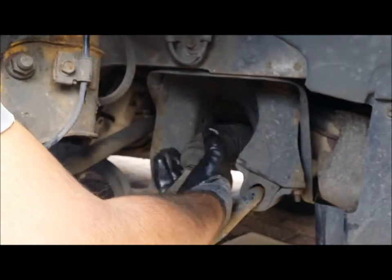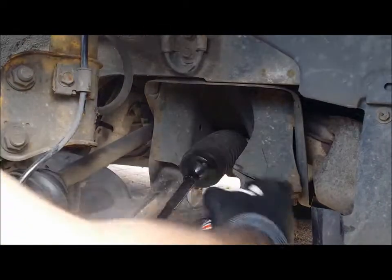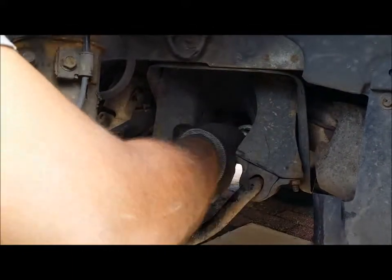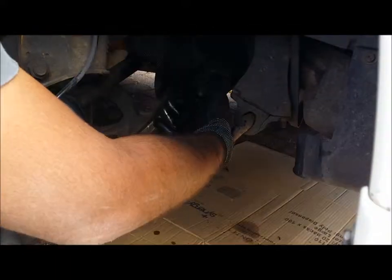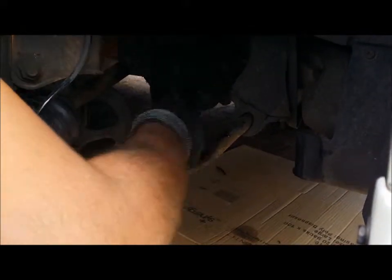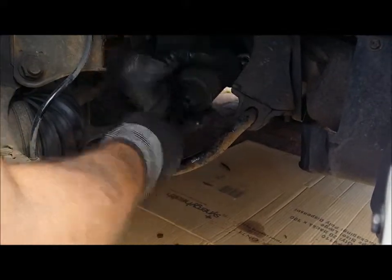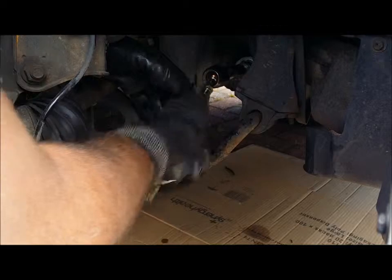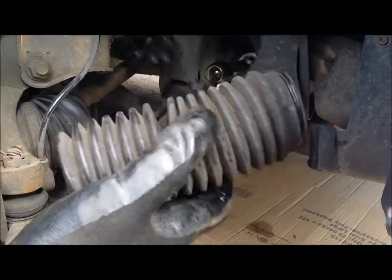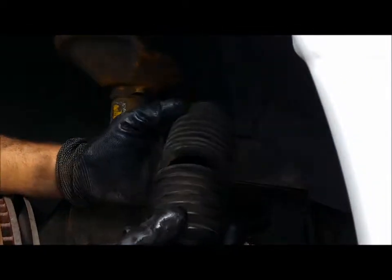But you'll see a lot of videos, which I've seen, a bit of lube needed on there. Let's spray the whole arm, make it nice and lubricated. A lot of the videos you'll see on YouTube are not very good at showing you this bit, because you just see the person trying to yank the thing off. Whereas if you turn it as you pull it, it literally just comes off really easy. Look at that. Two seconds, see that? And that's where it's broken on my one. Bloody rubber crap.